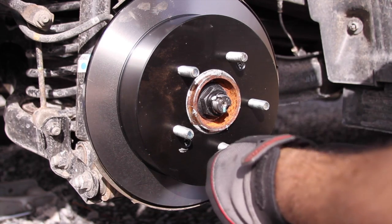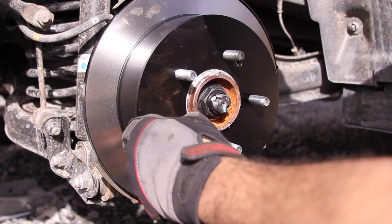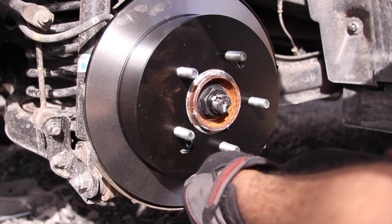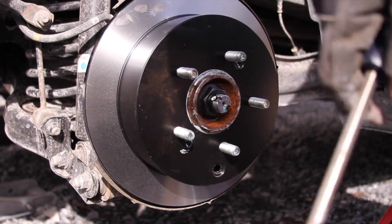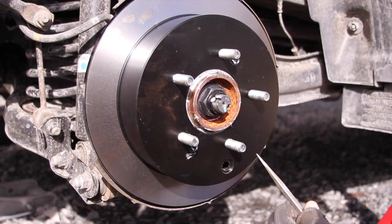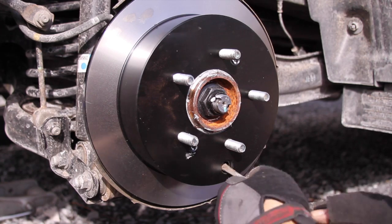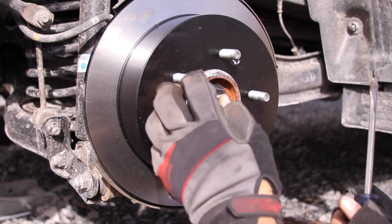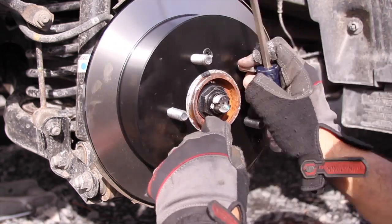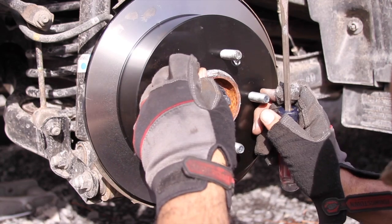Keep it going. I'm still not getting anything. In fact, I actually don't think I'm even hitting any teeth. I can't be, because you'd actually hear a spring being moved if you were hitting it. There we go. So now I'm hitting it. And then you turn it, see if you hear any noise, and there's slight noise and slight drag. And I think probably one more click up of the adjuster.